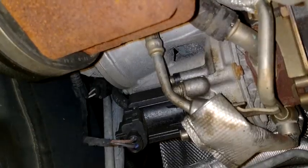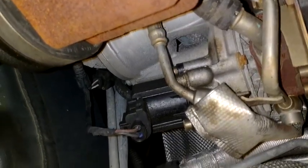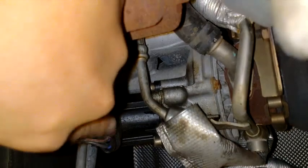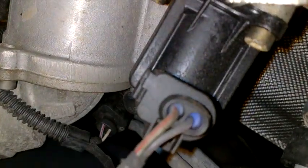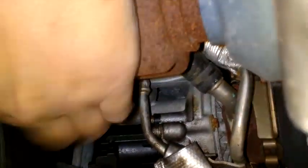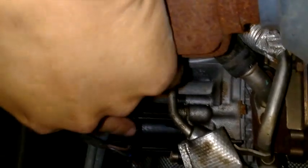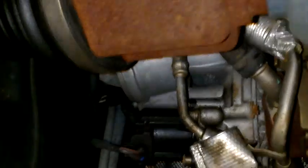I'm back. The turbo diverter valve is located right there — you can see where my finger is. There's an electrical connection there that you need to unplug. To find it, this is the oil pan and that's the oil drain plug — you just go back there and voila, that's the turbo diverter plug.